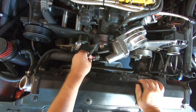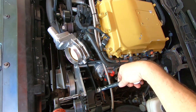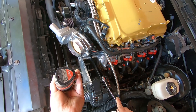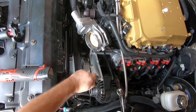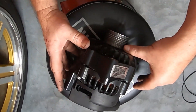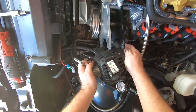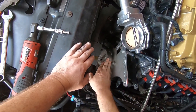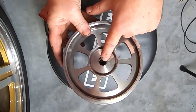Let's go ahead and focus attention on the alternator - it's just a couple bolts here on the ears of it. Go ahead and take those two bolts out and disconnect your battery as well - I went ahead and did that. There's also a single wire connector you want to disconnect, and the power wire back here. Actually, I'm gonna have to get a puller - pull this pulley off and then unbolt that. I'll bring you guys back once we get all that set. Got a little puller set up here - there we go, and that's how we do it.